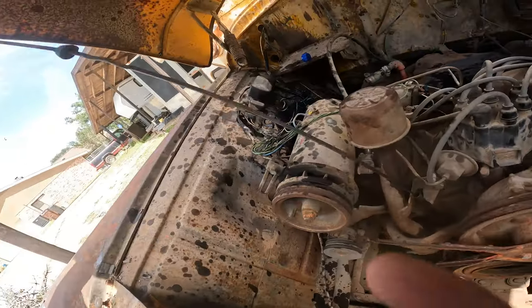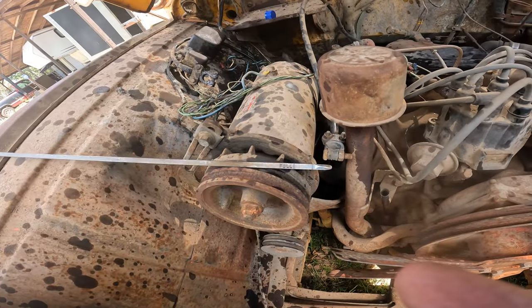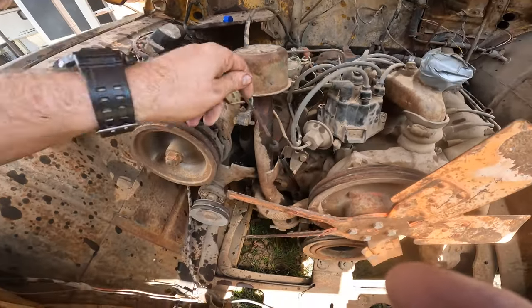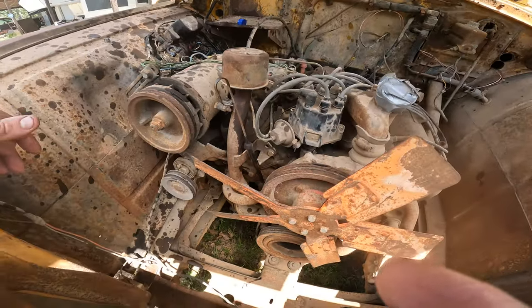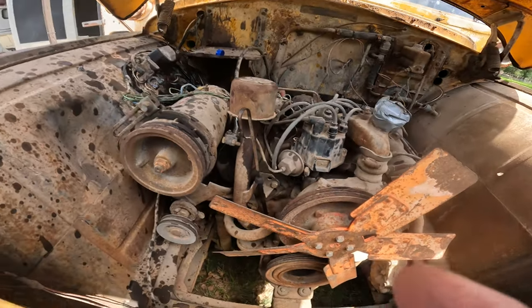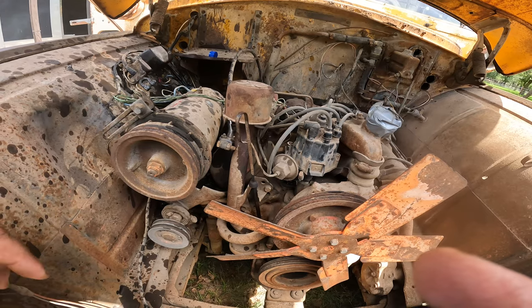A little bit of Marvel Mystery Oil in the engine. Still low on oil, but I'll just let it soak in there. I'll have to take out the distributor and run the oil pump for a while just to lube everything up,